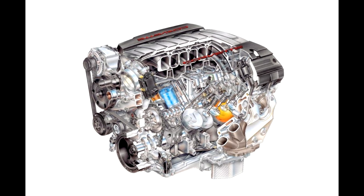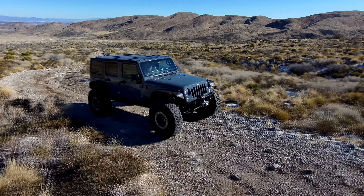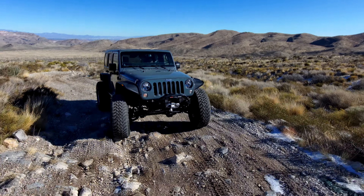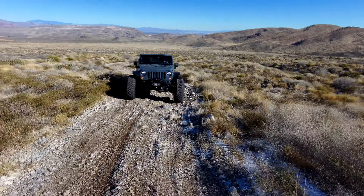So that brings us up to the LT1 — top of the pile, as we all know. There's the LT4, LT5, and all that stuff, but we're talking about the everyday engines that shops put in. The LT1 was designed for performance in a Camaro or Corvette. It has 11.5 to 1 compression and a high-capacity oil pan with a built-in oil cooler. The earlier LT1s had a different cam phaser than the later ones — we noticed no difference. I think they changed the cam phasers about a year ago for better compatibility with the other engines in production, like the L87 and L84. In any event, it is basically an L86 with a low-rise intake that looks really cool. Is there a difference in the cam and the programming? Yeah, probably a little bit, but the changes are really minimal — I drive them both and I would be happy with either one.